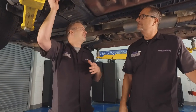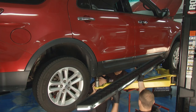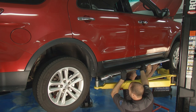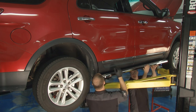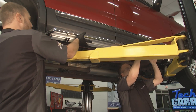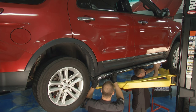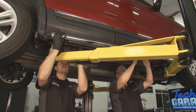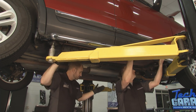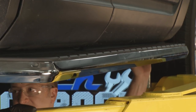What I really like is you have to drill a few holes, but at least it's just in the pinch weld, so it doesn't make you so squeamish about drilling into your car. This is a really nice step from Aries. On top, you actually have a weather strip — we need this weather strip to go underneath the door so when you wash your car or it rains, you don't have to worry about it getting on the carpet. These bolts come pre-installed; you can slide them back and forth right into the bracket. All we have left is the flat washers, lock washers, and the nuts. We shore up these brackets to tighten everything down — it's as simple as that.